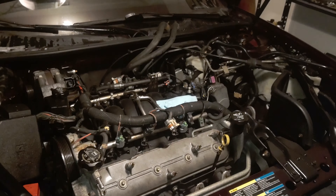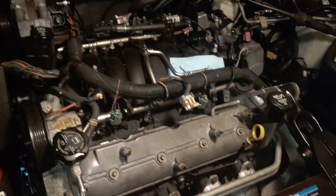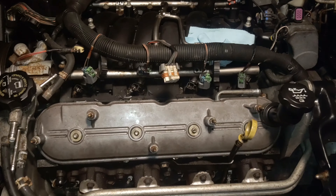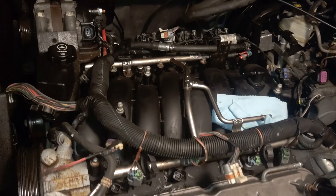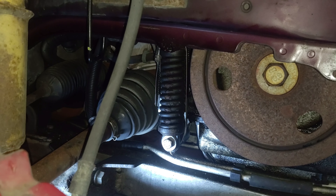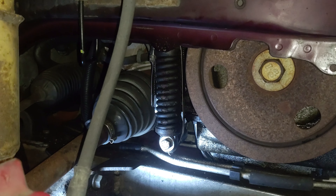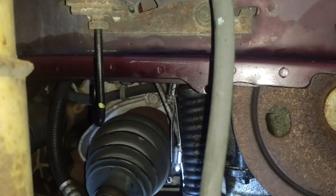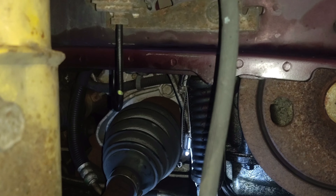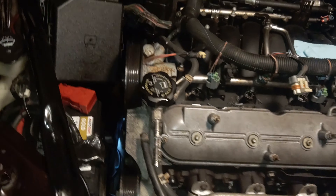Progress update: I've gotten a lot of the top end disconnected. The wiring harness and the front set of coil packs on the left side of the engine are out of the way, the rears are disconnected, and I have the fuel injectors all disconnected. Got the accessory belt off. Most people know the hose clamp trick - you need about a five-inch hose clamp, or put two quality ones together that add up to about that, and orient your worm gears properly.